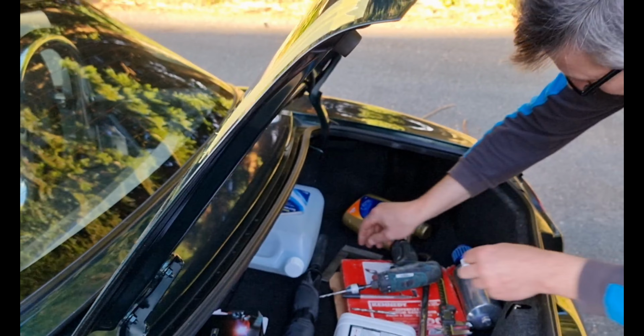We'll just offer this in place. We pull the studs out so we don't scratch the car, and we'll literally just drop it in place. Use the badge to line up the center, and because it's designed and built for the car, it sort of snugs into where it needs to go backwards or forwards. And we check the edges there, and then looking down from the top, make sure we're square with the car, and that's not a million miles off. So when we drill the holes, we'll drill them with a bit of clearance on them, so that'll give us some final adjustment to play with.